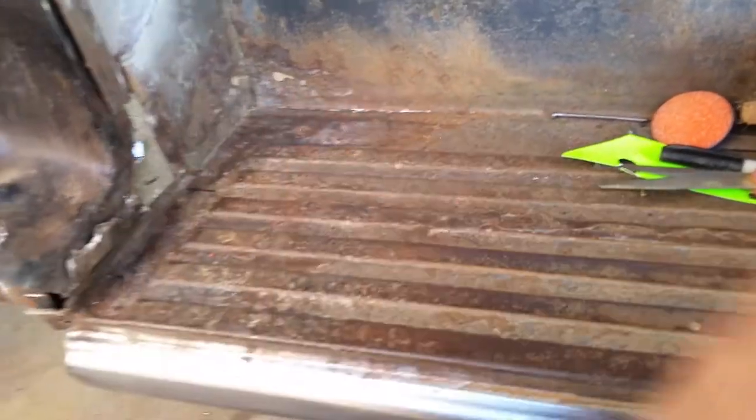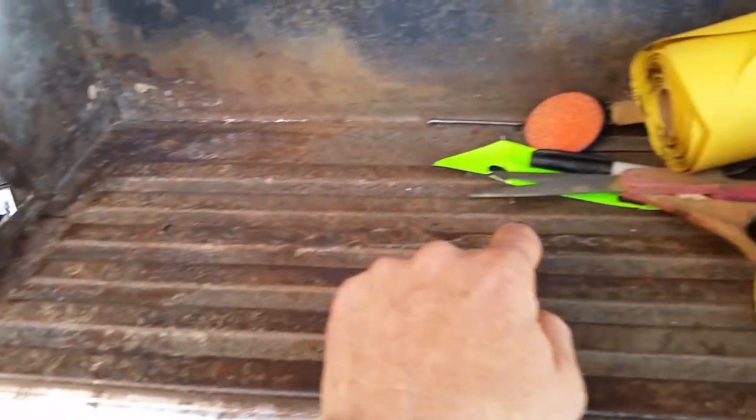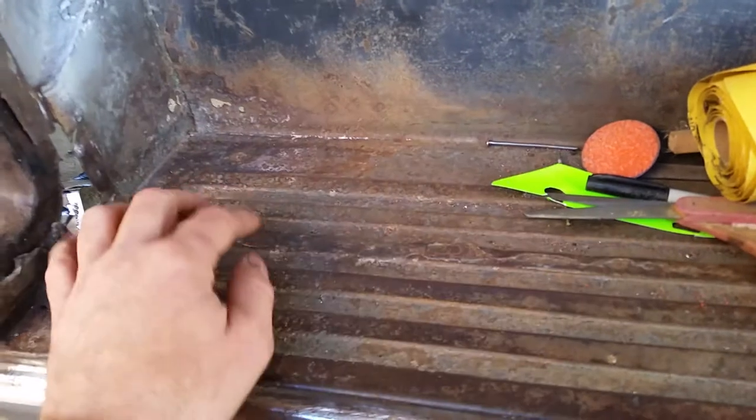This is really rusty. This was all painted. I used aircraft stripper and some steel wool, and I took it all off, and I got the kitty hair off of here. I'm sure that's what that was, because it's kind of goopy and stringy in that aircraft stripper, because I'll let it sit on there about 30 or 40 minutes.